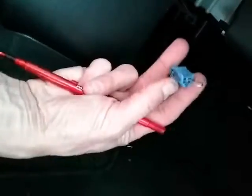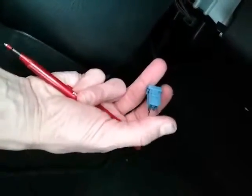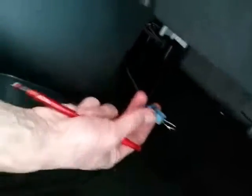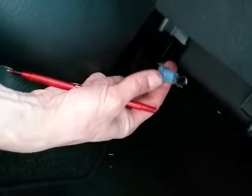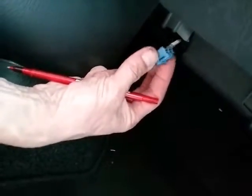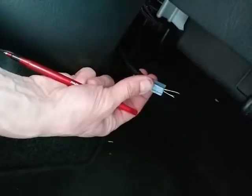The dealer will just have a little plug that snaps on here and jumps these two terminals. You can just use a paper clip. So this two-terminal plug — maybe 2005 and earlier models — you might have this port available. It can be anywhere, usually in the passenger compartment. This one happens to be near the center console.